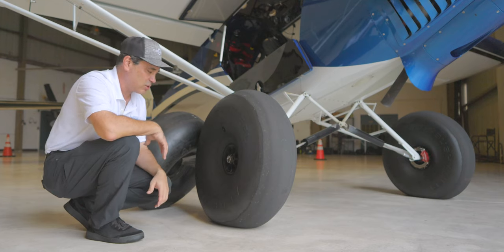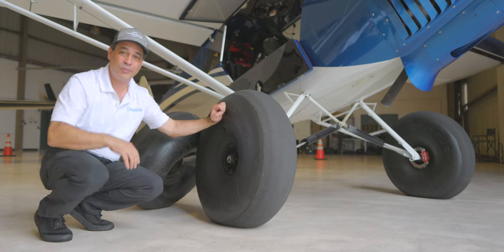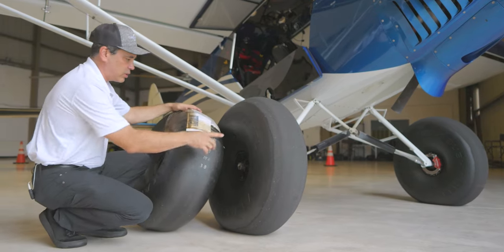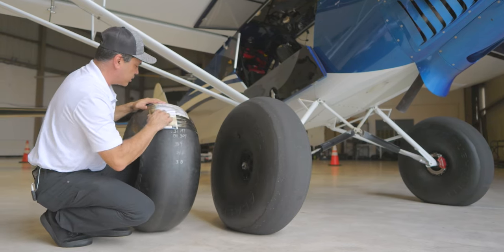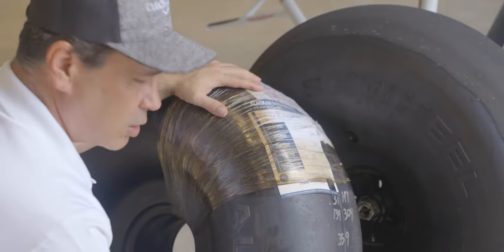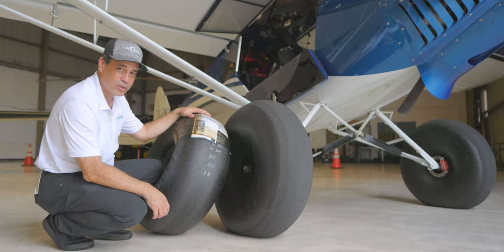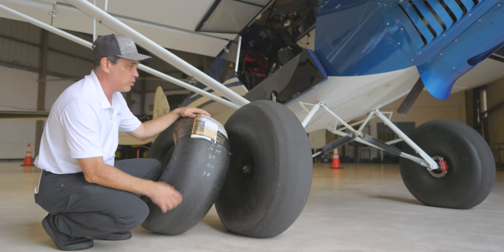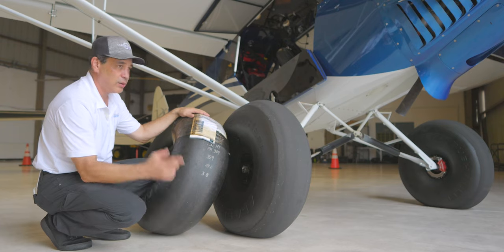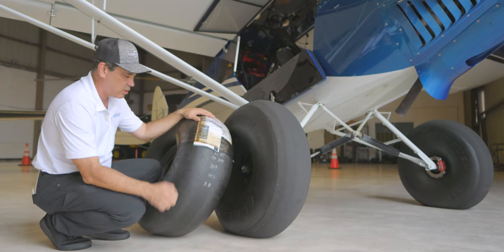The stem is actually built into the tire itself - this visible one doesn't fill the tire, the actual fill stem is up here built into the tire. So when the aircraft lands and this happens to spin a little on the rim, you're not tearing the stem off. These tires make for such a sweet landing - you can roll over rocks six inches tall and barely feel them. We're only running eight to ten pounds of pressure in these tires. Unfortunately they're really expensive - about twenty-five hundred dollars a tire, more than our jets. We just ordered these new tires which have the heavy tread version from Alaska Bush Wheels for a little extra rubber since we land a lot on concrete here. You'll only get about a year out of these tires on concrete, so this is the first time we're trying the heavy treads.